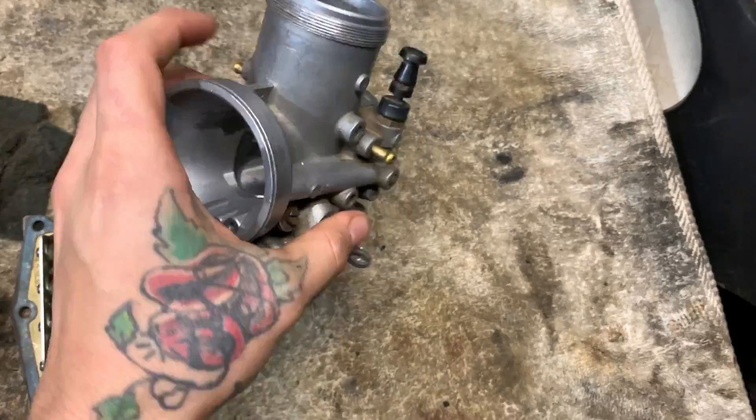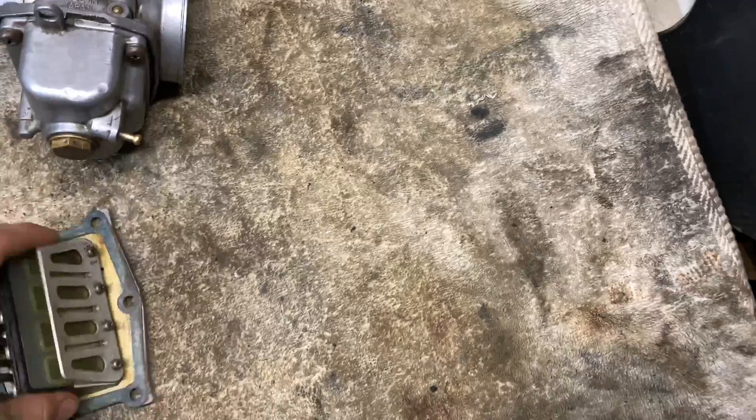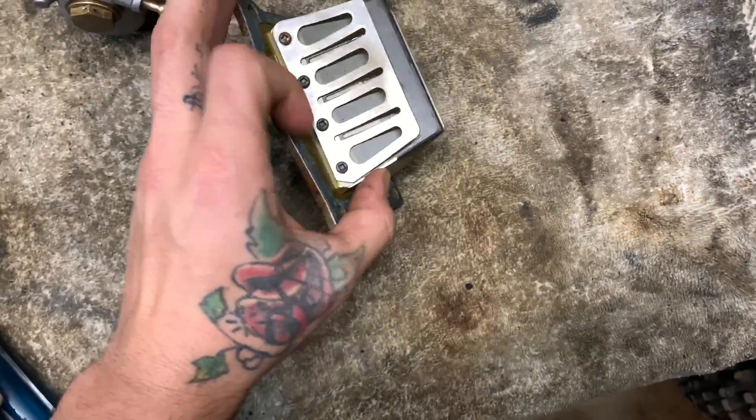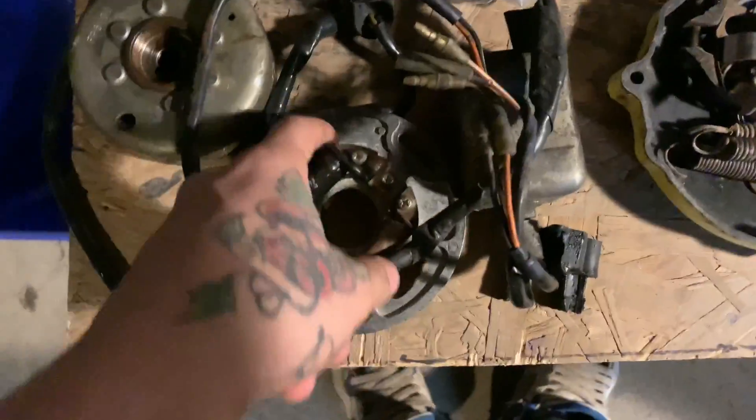I'm back. I went ahead and cleaned the carburetor and put it back together. You already know how to take it apart — just do the opposite. I also cleaned the reeds off camera. It's simple — just take out the screws on each side and the whole thing comes apart. Now that it's clean I can put it in the box and I don't have to wonder if I cleaned it. I wiped this down and cleaned off the rust as best I could.